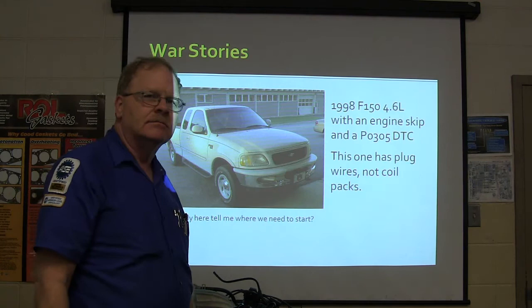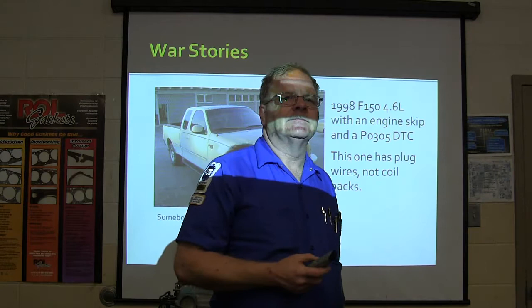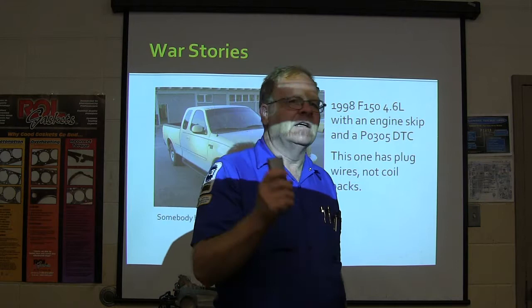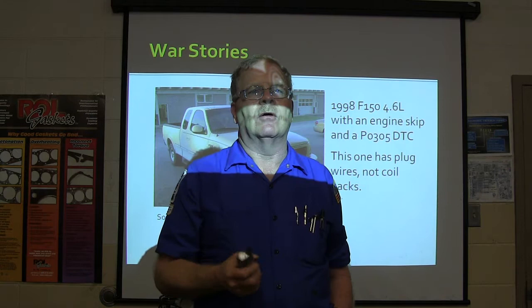Check the spark plugs - look at them, see what we've got. Let's say we pull the spark plug out and it looks okay, don't see a problem. Now what? Is there a spark going to it? That's not a bad plan. But I will tell you this - if one's misfiring because there's no spark going to it, the spark plug will typically be dark and greasy if you've had none like that. And this is a dead skip, right, with low power.